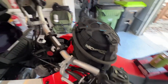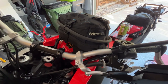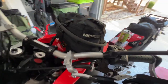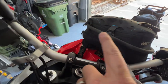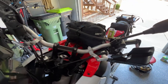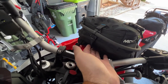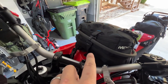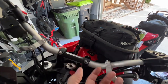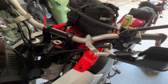If I move the handlebars all the way to the bag, it's just barely barely touching it, which to me is a perfect fit — it's not in the way of the hand grips, not touching anything on the controls. It's kind of a perfect fit for the top of the tank. After you cut the gasket that velcros to the bottom, I mounted it up, saw where it was making an imprint on the bottom foam, strapped it on, got a nice imprint, and was able to figure out how much I needed to cut for the foam piece that horseshoes around the gas tank cap.